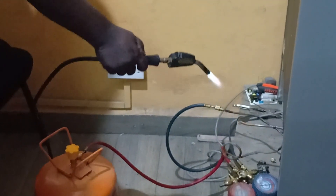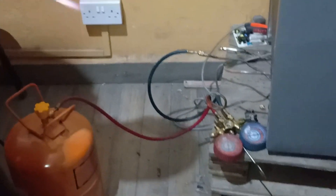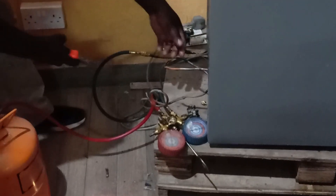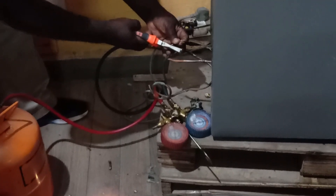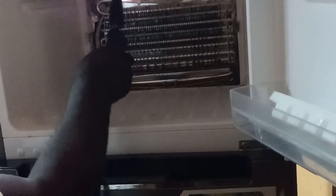You can see now at a distance what is happening — that means gas is coming out via the small pipe. That is good. I'll now close the small capillary so the gas does not escape. I'll just pinch it, being a small pipe. Now I'll use the flame — it will not come out, that means it is tight. Now I'll use the same flame to go inside the system and try to detect the area of leakage. I'm going inside and trying at a distance to find out any area that will produce flame. Anywhere that produces flame, that is the area of leakage.